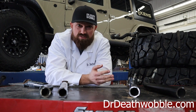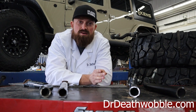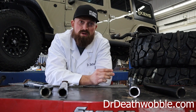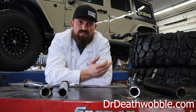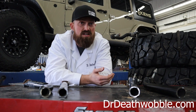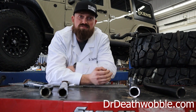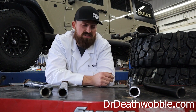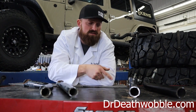Obviously there's two or three different dampers that FCA has come out with. They had steering gear issues, they had some reflashes, all kinds of stuff. But what I'm talking about is the guy that's been to the dealer seven times, they've done everything, and it still has death wobble. The reason is the window for resonance to come into that system is way too big — it's because of what they built the steering and the track bar out of. The vehicle is running low caster so it turns nice and sharp and gives a nice driving feel, but they're relying way too heavily on a strong stabilizer to knock down all that resonance. The vibration is coming in, and that insurance policy window is way too big. You are going to keep having problems with it. They'll redesign some stuff, but obviously they had ball joints that were loose, track bar brackets, all kinds of stuff — but the fundamental issue is right there in the steering and the track bar.